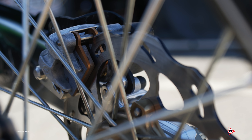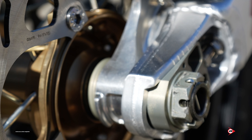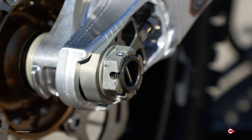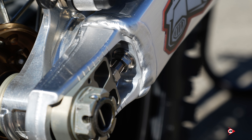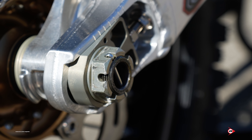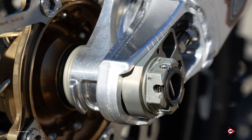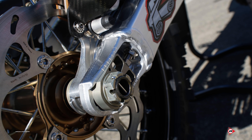We have an SR billet hanger with titanium pins. The rear axle is a titanium rear axle, DLC coated, and we run our own Pro Circuit axle blocks. A lot of teams get away from the cotter pin in the rear axle, but we like it — it's just a little added protection. Joe runs his axle farther forward than the rest of the team; he's found that he really likes that in the transitions and seat bouncing, and it's helped him a lot these last few rounds.